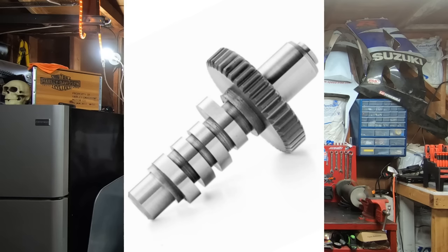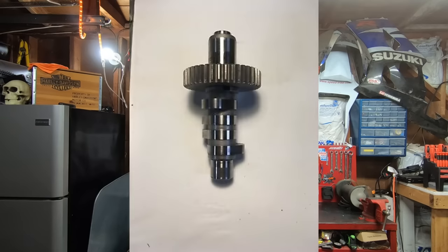For guys who have to stick with Harley-Davidson parts, Screamin' Eagle has a couple of cams out there at about $200. For heavier touring bikes, you're going to want to look at the SC4 cam, with an RPM range of roughly 3,000 to 5,000 to help with that low to mid-range torque. If you have a lighter bike like the Dyna or the Softail, you might be more interested in the SC11. The SC11 comes on a little later and runs out a little further compared to the SC4, at about 3,500 to 6,000 RPM, and it's also $199.